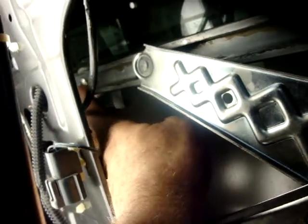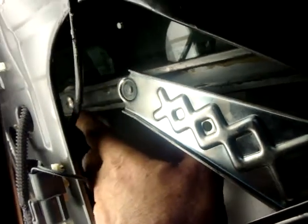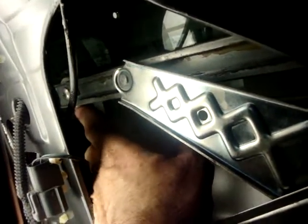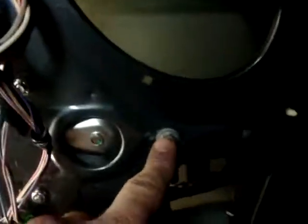What I ended up doing was — this little tab right where my fingers are — there's a little tab right there. I bent that in. So I bent that tab and that allowed me to proceed. Once I removed the motor and got that all done, I drilled out the four rivets. This track here comes loose and then the whole motor is loose.